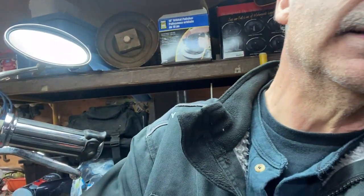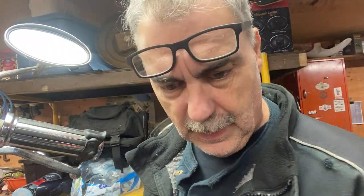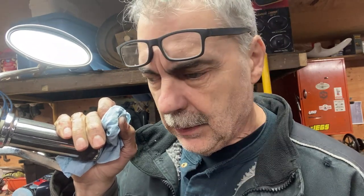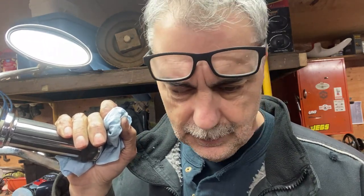So, these heads got to come off. This head. Now we're into a big job. I thought I'd just get this thing fired up running, dial in the carbs a little bit, and then start working on the forks and the brakes. Brakes are seized, fork seals are done. Head gasket, I suspect, is leaking because it's wet around there. So if we can get it running good enough for now, I was going to see what he wanted to do with it.